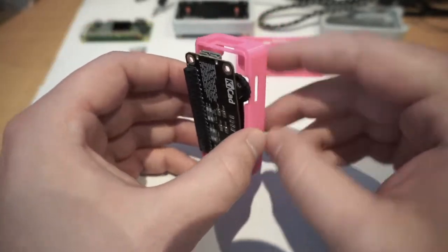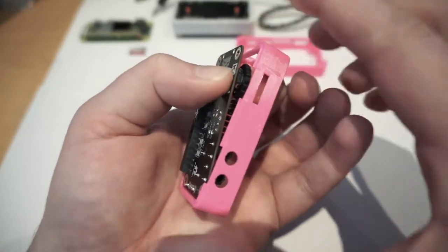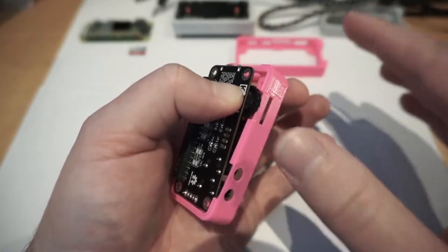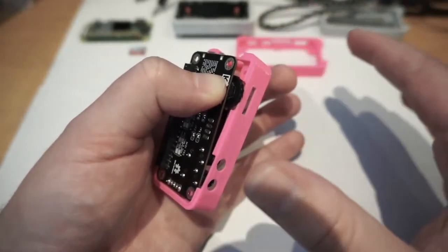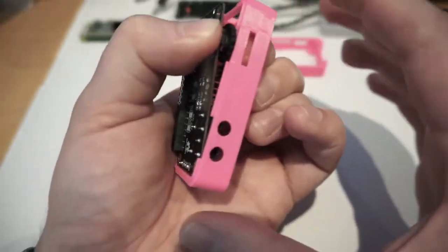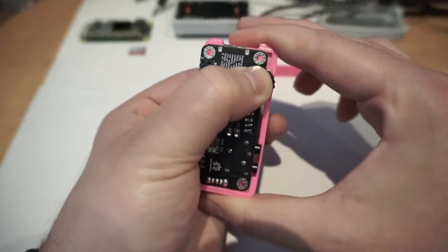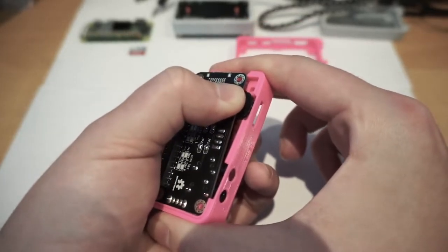Once you get it to this stage, take your finger and thumb and grab the wheel nice and tight. What you're doing is pressing the wheel against the PCB so that it stops the wheel from being moved up, down, or away from the PCB. Keep the two together nice and tight while you work on the case — that means the wheel can't get ripped off and you'll avoid damage. Avoid pressing any switches or damaging anything else. Just get your finger on top and press the wheel. While keeping that wheel pinched, take your other hand and start manoeuvring the case around. Bend it around the wheel and push the PCB down at the same time.